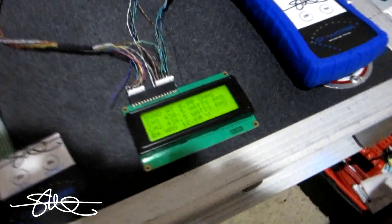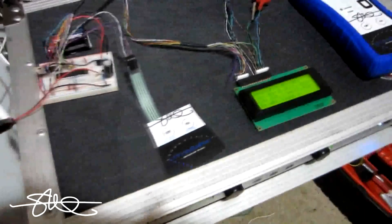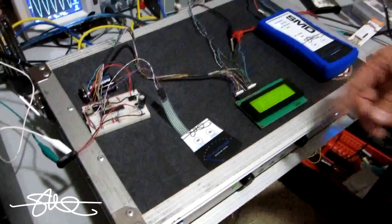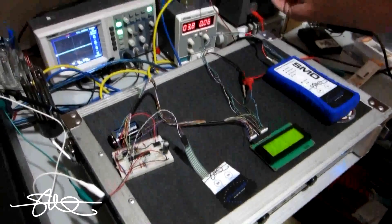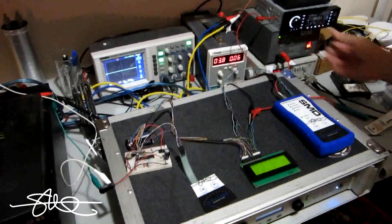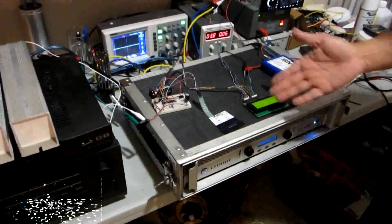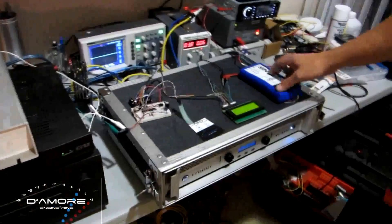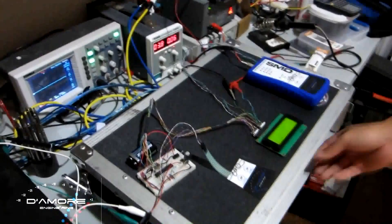I don't think we had the gains all the way up — the DD1 isn't detecting any distortion at this point. Our gains just aren't high enough. When the DD1 detects distortion it'll automatically read that as the highest power achieved. So we have to adjust our gains. This is like a customer coming in — they dynoed at 439 watts, then you take the DD1 and set all their gains properly.